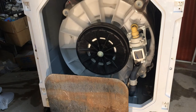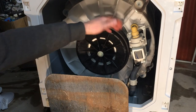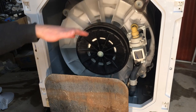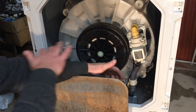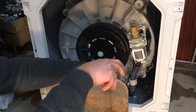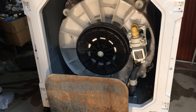Now what you need to do is lift the machine back up. If you had it on a 45-degree angle bailing water out and working underneath, when you lift the machine up there will be a bit of water coming to the pump. You can then test it and tell straight away if it's actually moving the water. Add a little bit of water so you've got some pressure, and then check all the joints here to make sure there are no drips. It's good to dry the ground underneath or put a piece of cardboard down — the drips will show on the cardboard like having a new dry floor. Then plug the machine back in, give it a test, make sure it's draining, check for leaks, and you're done.